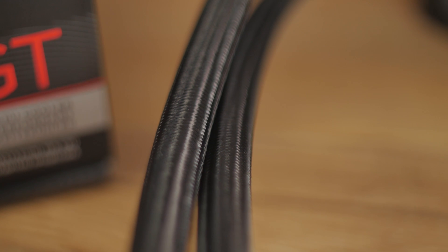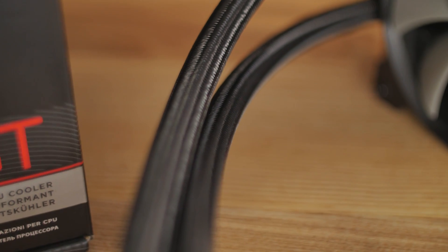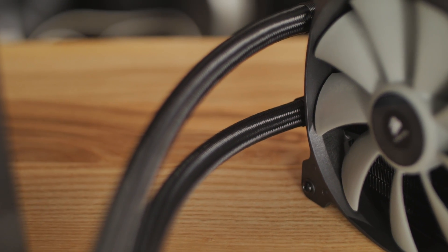We've done a lot of tests lately with different water cooling units, and this is one of the best. I also love how slim this is. Being 280mm, it's going to limit case options, but most modern enthusiast cases do support that. It's going to allow you to overclock, and if the software and RGB are your thing, it's a great way to go. The only thing I didn't love was the noise — it got up to 66 decibels. Not terrible, but I thought it would be a little quieter. You can get more silent aftermarket fans, and if you put this in a case and close it up, you're probably going to lose 10 to 20 decibels. That was measured with the overclock running.